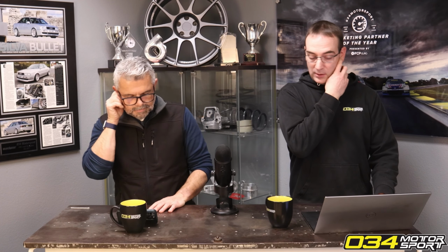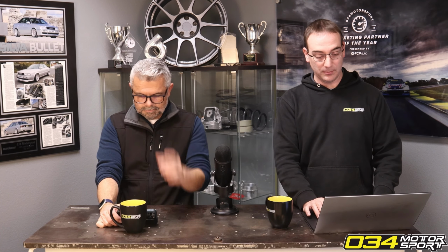I mean, you're talking like probably a 2.5 inch gap that the bolt is just floating in with its shoulder resting on the bottom of the subframe. Yeah, because the subframe's about 2.5 inches thick. And it's maybe a 3/4 inch, 7/8 inch hole. Yeah, and it's got a lot of side loading and twisting on it when that chassis and suspension was flexing, like Gerard said, like sharp driveway inclines on track.